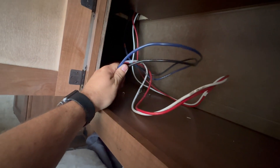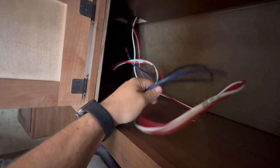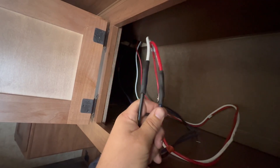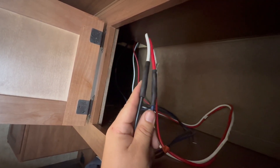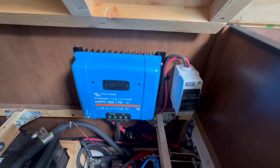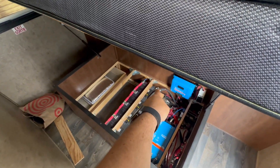So we're in the back bedroom here, and behind this cabinet above the bed there's an access hole, and that's where you'll find these sets of wires — a black and blue, and a white and red. Here's where we did the splice; we just connect these straight together, but you don't want to do this until you unhook it down below, and I'll show you where to do that. Normally you'd put a charge controller right in there, but we wanted to do a larger controller, so we had to run the wires from here all the way down to the compartment where they come out, then run that into the controller.